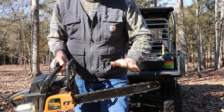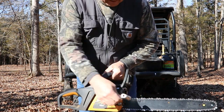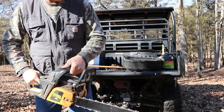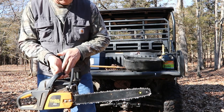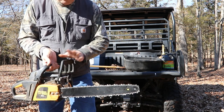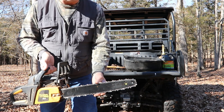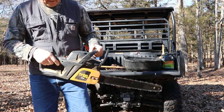This is part of the warm-up process to make sure you've got this thing ready to go to work. So now our chain's tight and the saw is basically ready to operate. What you really have to watch for, if you're new to chainsaws, is once you start sawing, you don't want the saw to kick back — that's what our chain brake does. If we're going to set this saw down, a loose chain will just continue to spin until you engage the brake or shut the saw off. If you forget and set this saw down and step backwards on it with the chain turning, now we've got a problem. Chain brake works — shut the saw off when you're going to set it down. That's always the best practice.